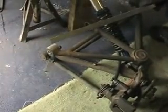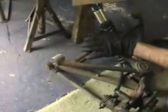Let's have a quick look at how the suspension is mounted to the chassis, starting with the top wishbone. There are two mounting points with bushes inside — one here, one here, this one I've removed. These connect to the chassis here and here. We'll have a bolt that goes straight through and the nylon nut is attached on the other side, with the bushing sitting in there.